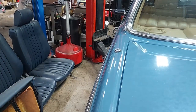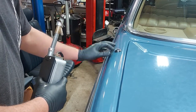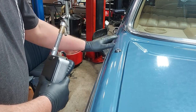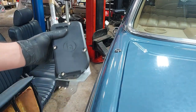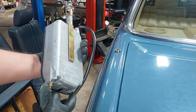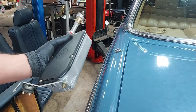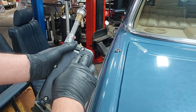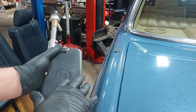The chrome bezel is free to be removed but it's been on there for 40 years and it's not moving, so I'll leave it. One of the things I like about the 1982–83 cars is this nice metal housing Hirschman antenna. In 1984–85 they changed to cheaper plastic housings with much more complex internal parts — they even added a circuit board — and you don't have any of that in here. Let me show you the difference on the bench.